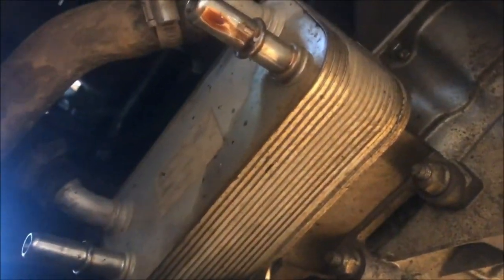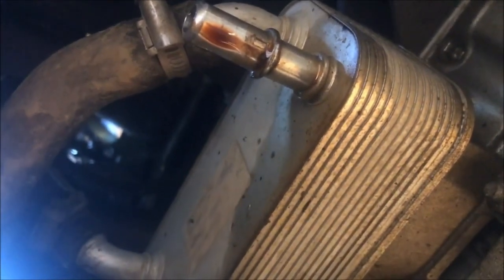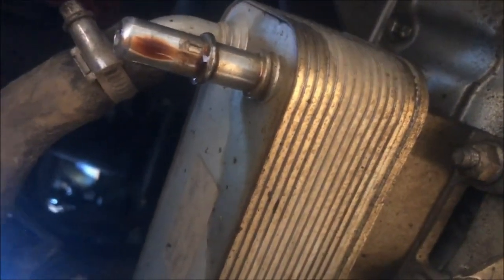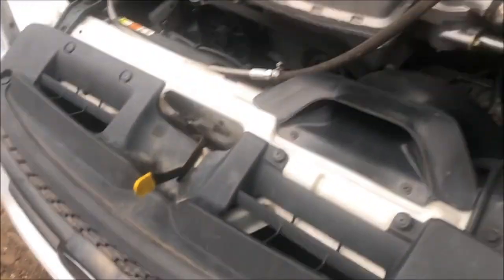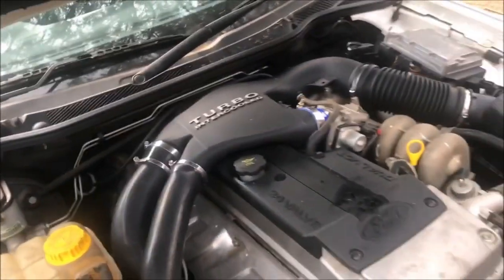There's one more thing I want to do — I'll wait till I get back on my mate's hoist. I want to pull this cooler off, disconnect the water, and loop that around, because these are known for failing on the inside and you end up getting water in your transmission. The cooler sits in there nicely. I've just been for a test drive and it's not even anywhere near as hot as it used to be. The next time I see you will be at the tuner — I can't wait.